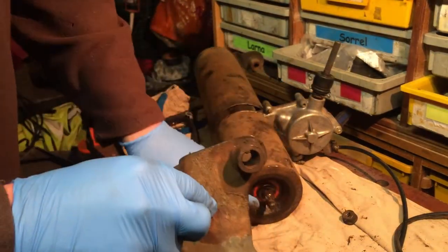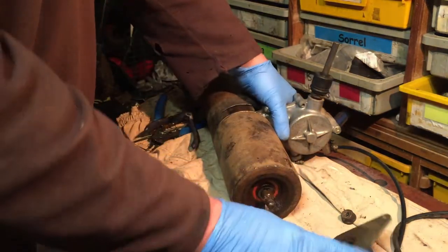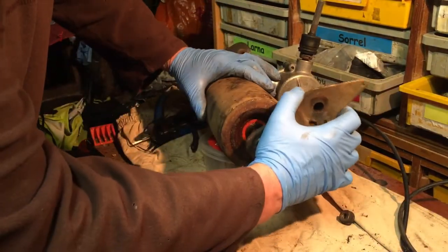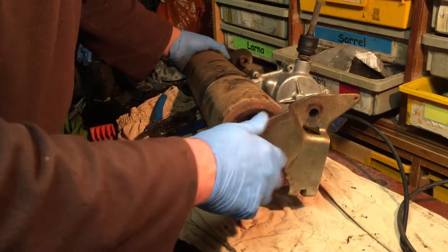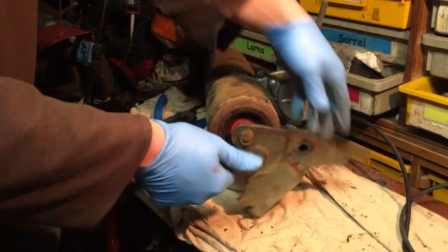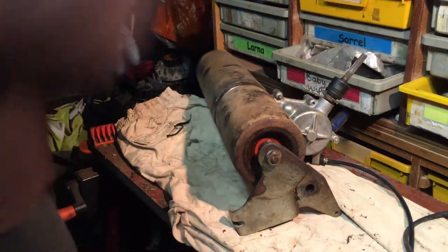You can't really put this on properly until it's back on the mower, because you bolt the opposite end first and then this slips on and holds it all tight. Those two bits coming out won't allow you to get it on — this has to slip on afterwards, and then the height adjuster and everything goes on after. But for the purpose of the video I'll put it on just to show you. There's a little keyway in there — sometimes it falls out, sometimes it sticks in there. That's all in there, so all that has to be done now is just locate that into the slot, and then all we've got to do is the final nut. I'll just nip that up to keep everything together for now. That's a complete service of the roller on this HRD.